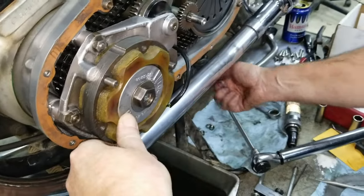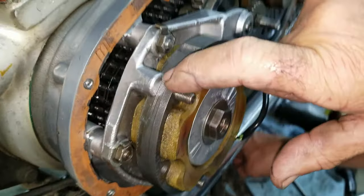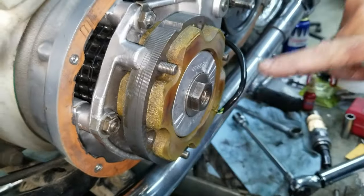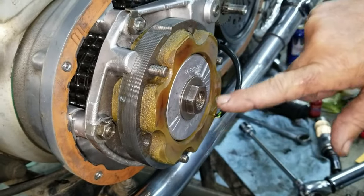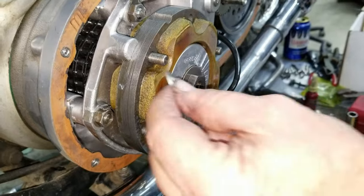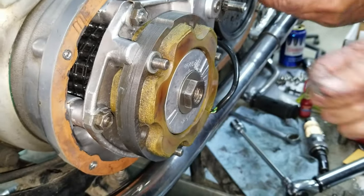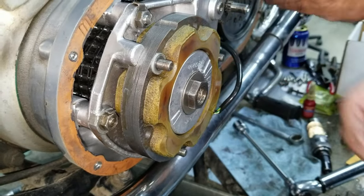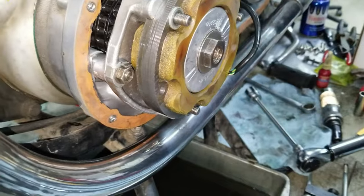These Mark III's normally don't come out of center because these are milled and they fit just right. They're in the right spot. But it's always a good idea to take an 8/1000ths and make sure it rubs all the way around. And we can do that here in a second. Yeah, you can't get your true reading without this being tightened down.